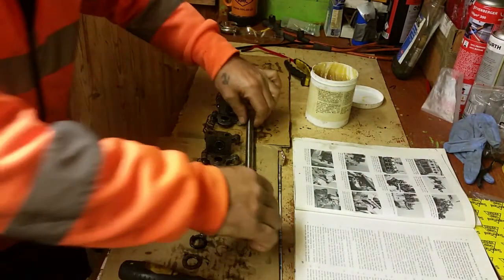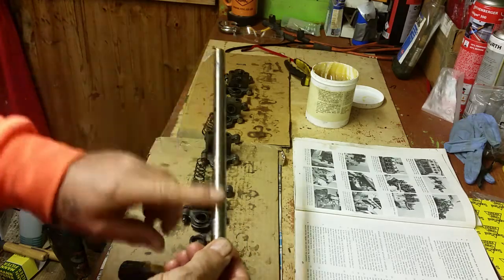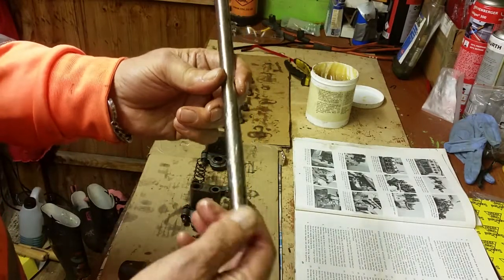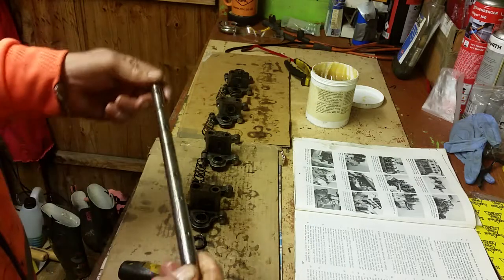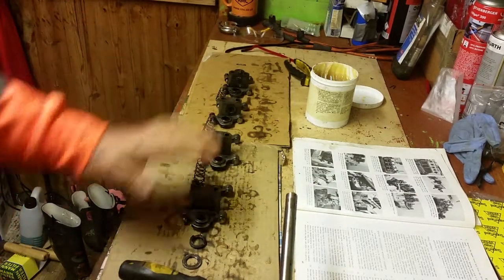And these shafts, you can get on Bull Motif or any of the owners club forums. Make sure you've got your split pin in the end to start rebuilding. I've checked this shaft and it's quite serviceable, and I'm quite happy to use this shaft again. So make sure all your parts are in the order in which you're going to assemble them.